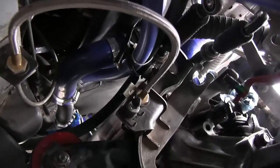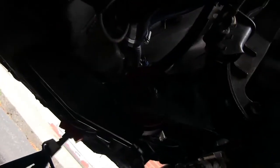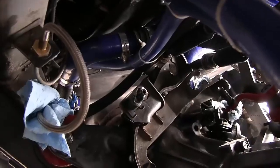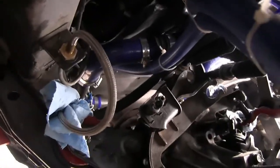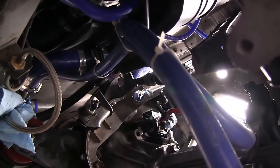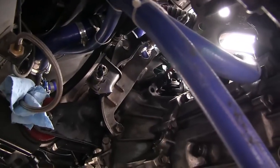Then we are ready to go ahead and start unbolting the engine mounts — there's one at the front, one at the back, and one on the left and right — and that's going to drop the engine. The clutch line is now removed; not too much brake fluid came out, so just have a little towel ready. You can see where we've disconnected that hard line from the transmission. Now we're ready to take off the engine mounts, lower the engine onto a dolly, and remove it from the engine bay.